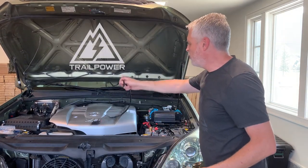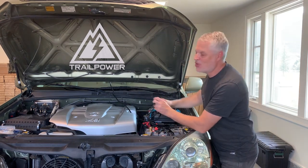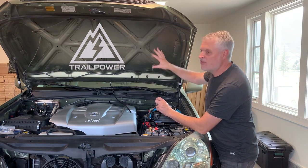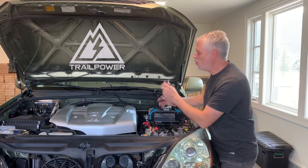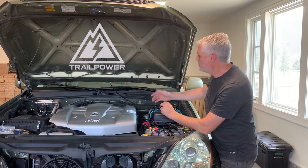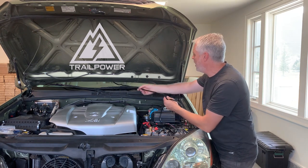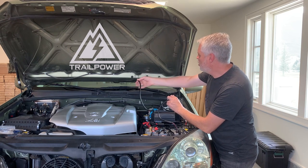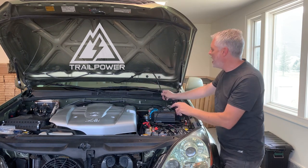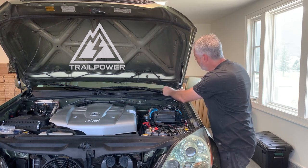Here you can see we've got our lead coming from our solar panel. We've also removed the insulated cover from the inside of the hood — we left it off since we removed it during our vinyl install. If you still have your panel on, you don't have to remove the whole panel; just loosen one quarter of it so you can tuck the wire up underneath and behind. Pull the wire snug so there's no extra wire on top of the hood, then wrap it under the tab that's part of the connection for the insulated cover.